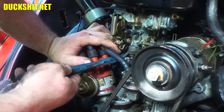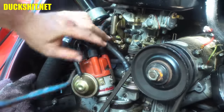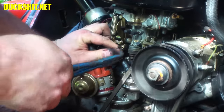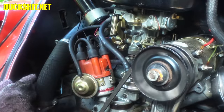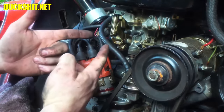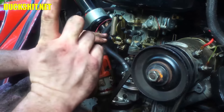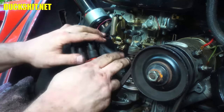There it goes. All right, now we're through. Boop. Just like that. Pull it. Gotta get any slack out of it. We're good. But don't pull it so damn hard against the gas pedal. Otherwise, what you're going to run into is a cable that's so tight that when you floor it, it's going to stretch the cable, which will cause it to break prematurely.